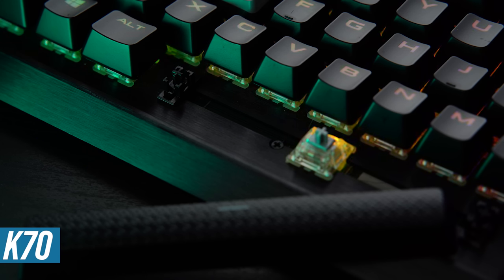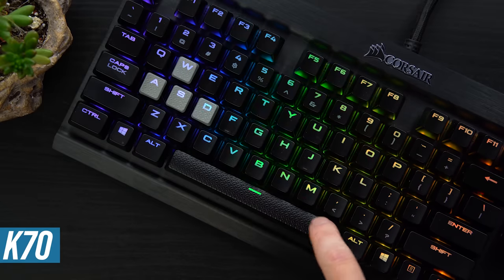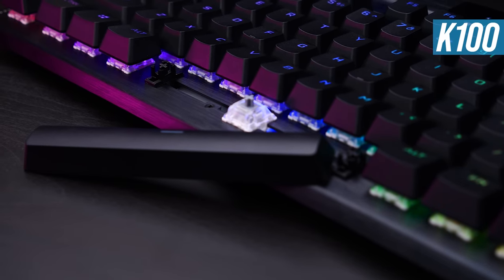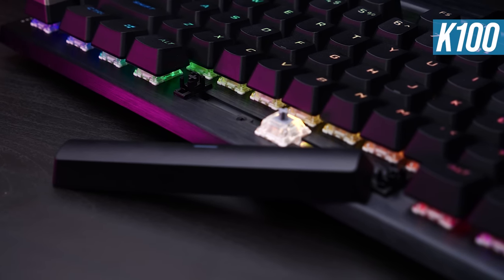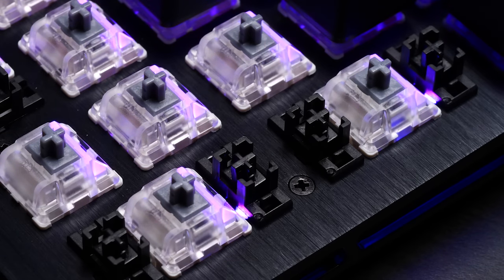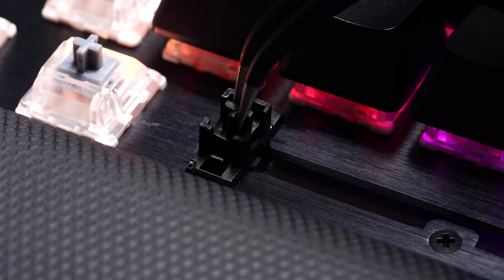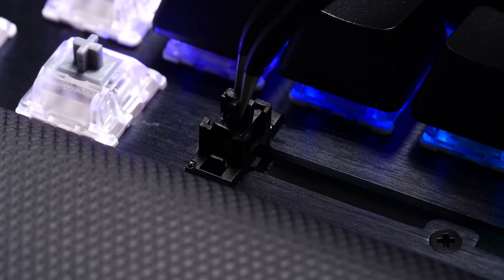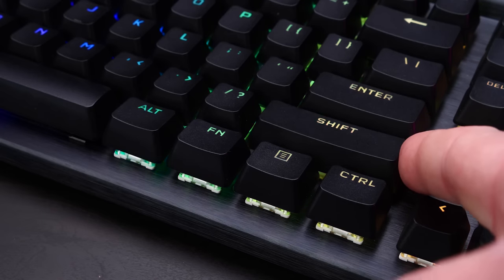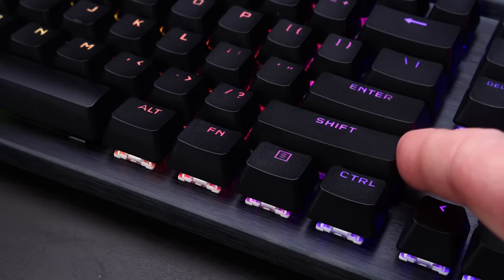One of the things I've knocked Corsair for in the past was their stabilizers. The K70 was my first RGB keyboard, one that I had to save up for, and one that didn't have the best sounding spacebar out there. Naturally, this is the first thing I went for when I unboxed this. They're using Cherry clone stabs here versus Razer's proprietary stabs. These are a big improvement over previous generations. While there's no lube visible in the housing, they definitely feel and sound lubed. They're all nice on my copy, except for maybe the right shift, which has just a hint of rattle.